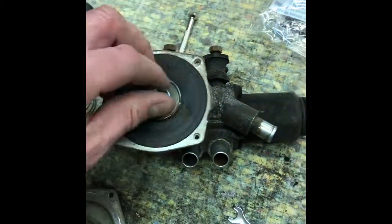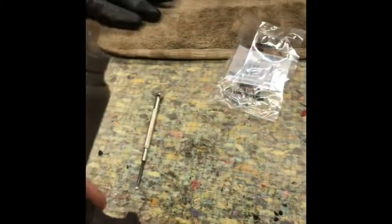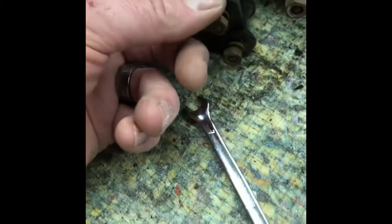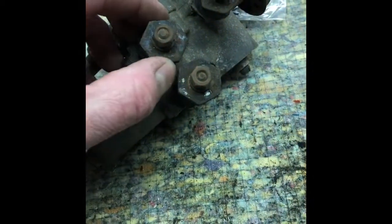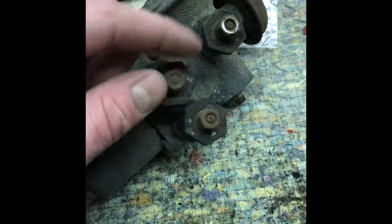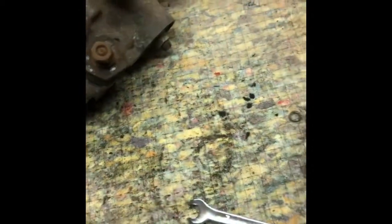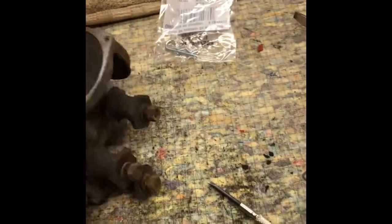It's pretty aggravating that they don't sell this diaphragm — somebody out there needs to make it. The electrical components inside this can be corrupt, they can be fixed, but nobody sells the diaphragm. These little arms right here, I've got some coming. On eBay they sell the exact same thing for a 2000 Volkswagen Jetta — I think it holds a fuel pump. It comes in a pack of three. I messaged them and asked what size the bolt was, because on these it needs to be 6mm. The ones on the 2000 Jetta were 6mm — they look identical.